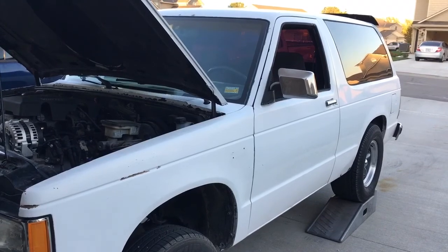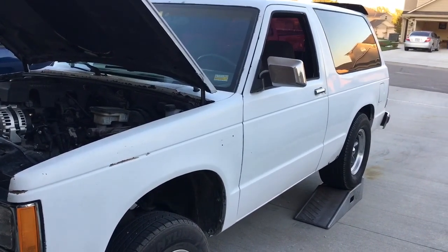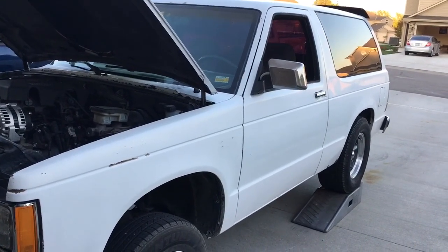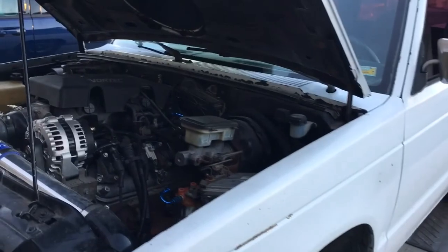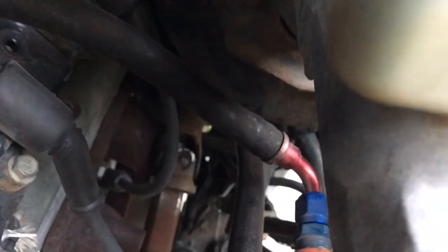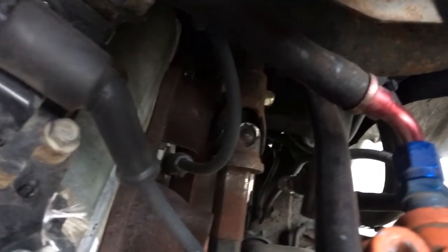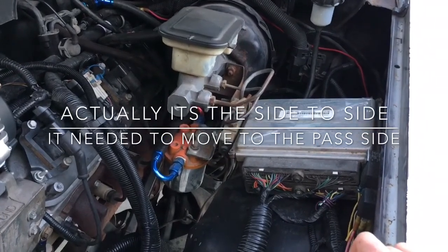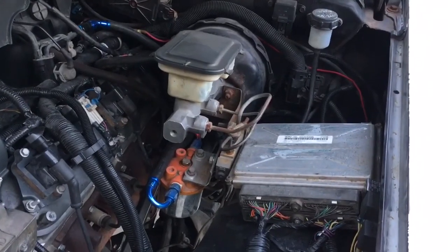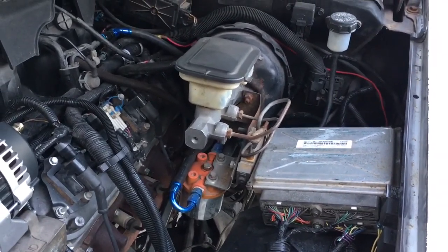In our attempt to set my pinion angle at my transmission, we raised the transmission, which — we found out — means I'm not capable of properly setting up the pinion angle on my transmission in this vehicle unless I lower the engine. That's a whole different video. We found out, when it was too late, that by raising the engine so high, the exhaust manifold ran into the steering shaft. So at this point my vehicle is almost undriveable because the steering shaft is literally pinched up against the top of the exhaust manifold. I'm going under to get some video to show you my little adapter design and show you how I'm going to lower the back of the transmission.